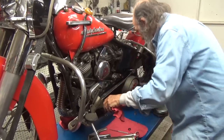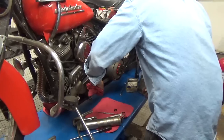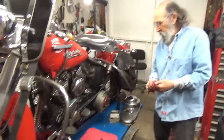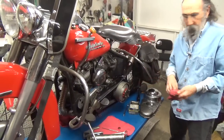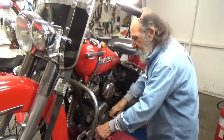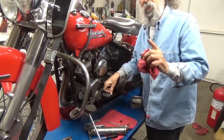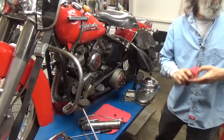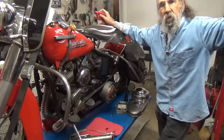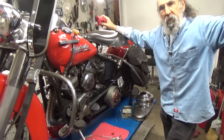Okay, that's the clutch itself. That's okay. Sorry, can't lube anything in there. Okay. So that's as it is, and boy, it looks good too. So I'll put this back together as soon as I find a nut for that clutch pedal, and we will tighten it so that it will stay in position when I've disengaged it, but you don't ever trust it. In other words, if you take your foot off of it and that thing should decide to engage, you will be in the middle of an intersection before you got a chance to do anything about it. So don't ever trust one. So other than that, I think that's about it for now.